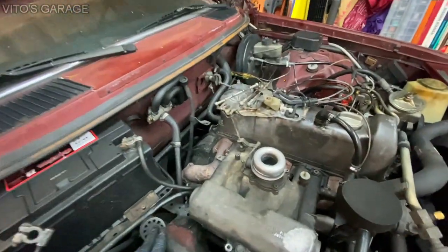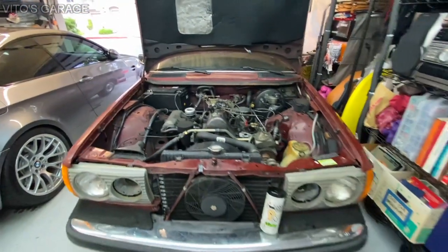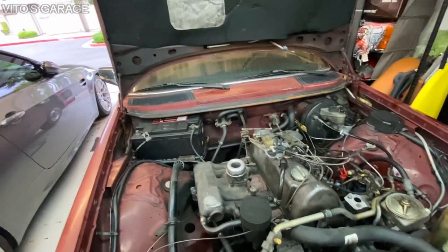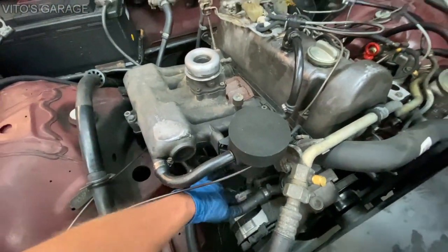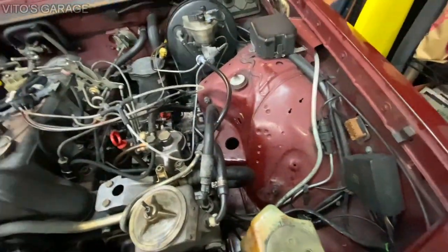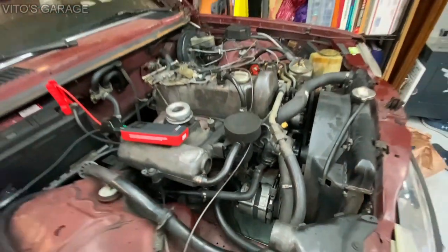It's a good thing we noticed that. A really good thing is that the loose starter did not damage the flywheel — that's really important. We're about to start it up and see how she runs. Maybe the alternator has already charged the battery. The alternator looks fresh so we'll check on that. Oil is good, everything is out of the way — let's see how she starts.